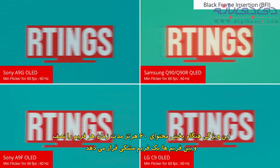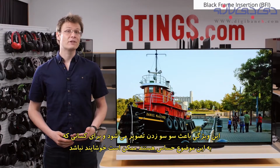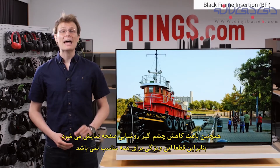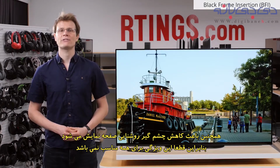Like the A9F and other recent OLED TVs, the A9G also supports a black frame insertion feature. For 60Hz content, this displays each frame for half the duration with black frames in between. It works well to clear up persistence blur and is useful for gamers. Those sensitive to flicker might find it distracting, and it reduces the screen brightness significantly though, so it definitely isn't for everyone.